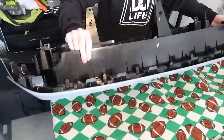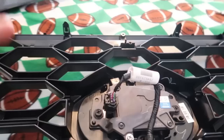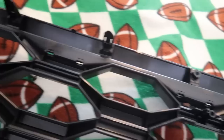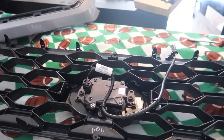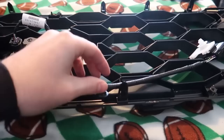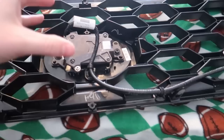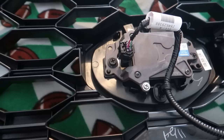I was able to separate it. There are eight screws in total: one in the center on both sides, on the top and bottom, and then three along the sides. Clip-wise you've got two on the top and six on the bottom. One additional clip I wasn't expecting was mounted up inside — you had to separate this and then push that clip through from the inside. That clip was at the top, tucked in there, but I was able to get it out.